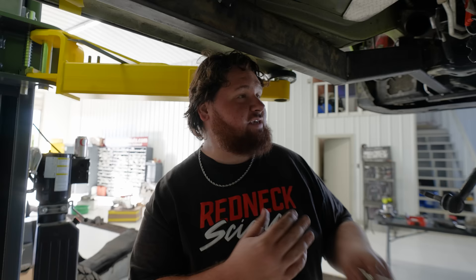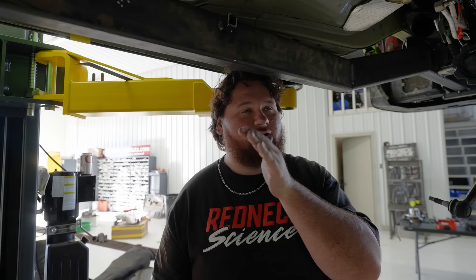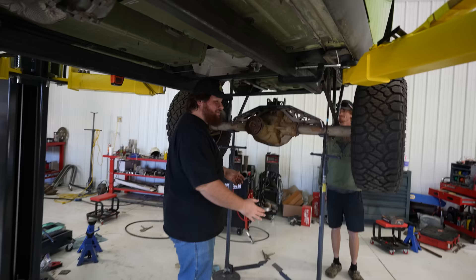There's a whole process to what we're doing here. Once we get this transfer case in its designated location it's going to stay there, and then we can start figuring out where all the axles are going to go. We need to figure out driveline angles — the driveshaft angle from the transmission to the axle needs to be a good angle. Once we get it done it will be right. This is our suspension — it's done.